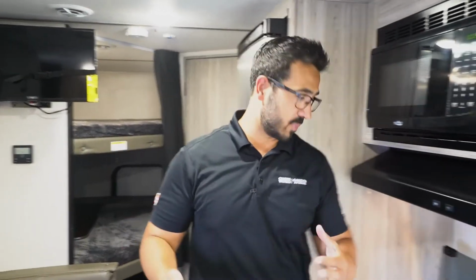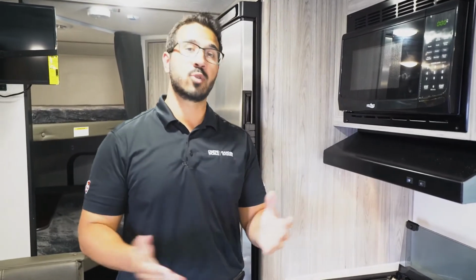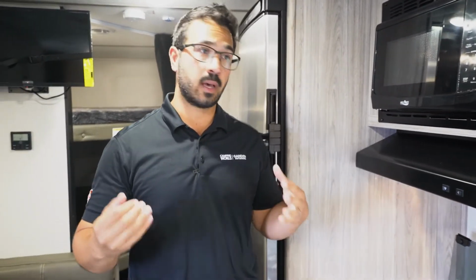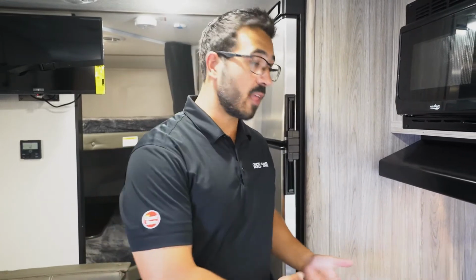And that wraps up the basic usage. So what about some troubleshooting? Well, if it's not lighting, the first thing I would always check is propane, folks. That's going to be the fuel source. You'll want to make sure that you have propane in your tank, and if you have 2 propane tanks, make sure the proper one is selected. If you have selected the right tank and you're still having issues, and nothing is lighting at all, well then again it's probably still a propane issue. So that's when you're going to want to check your regulator.